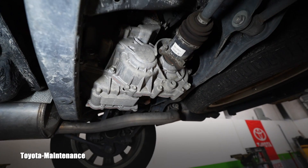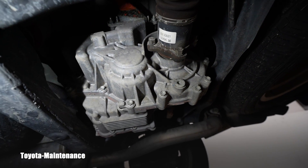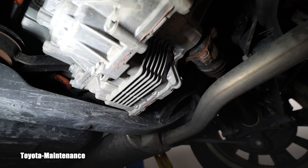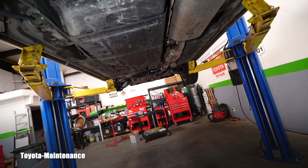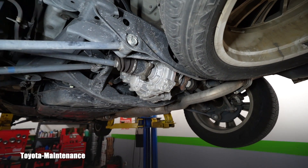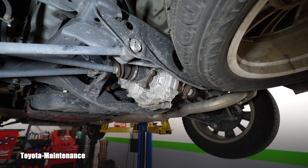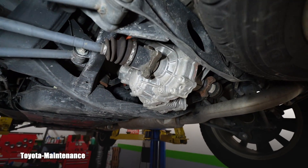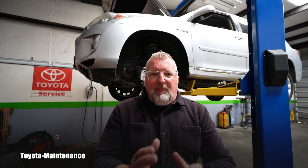Another important detail: this is an electric motor-driven rear transaxle — it is NOT a rear differential driven by a propeller shaft from the front. This is completely different technology. And Toyota WS ATF is inside this one as well.